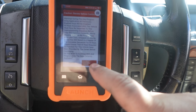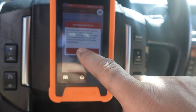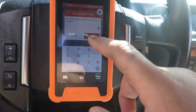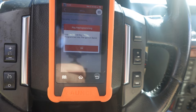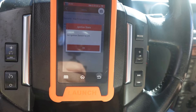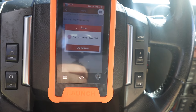It's going to read you a very frightening declaration. We're going to go OK. The following steps will instruct you various ignition prompts — it is important that these are followed exactly. How many keys are you programming? I think I'm programming two — I've got the existing one plus the new one. OK. Insert the first key to be programmed into the ignition barrel — it's already in there. OK. Set ignition switch to off. OK. Please ensure the ignition remains in the off position until instructed otherwise. Communicating.